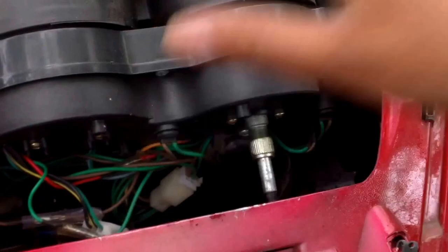I'm gonna remove two bolts down here — there's one nut there and another one right there. Then you're gonna remove a screw there, a screw there, a screw right there, and a screw on the side. Same procedure on the other side. Then on the inside there are four screws — one there, one there — holding the radiator cover plate, and the same on the other side.